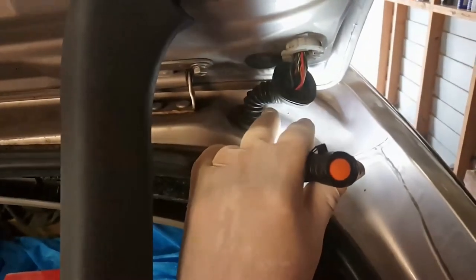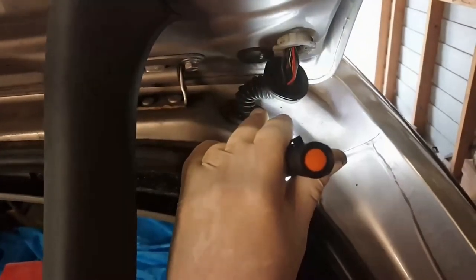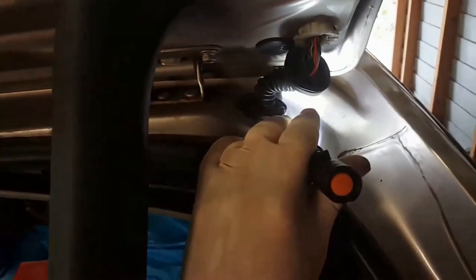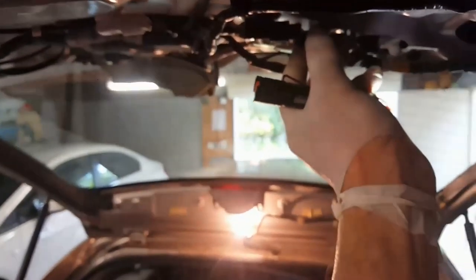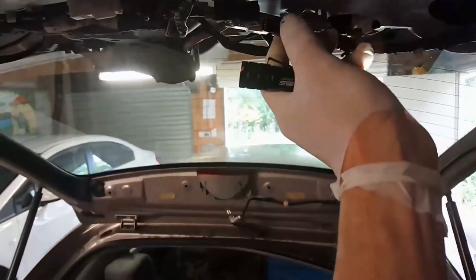At this stage it looks like I have to remove and cut this rubber boot off and just have a look at the wires. Another option is when I disconnect this connector here — when I disconnect this, the light will go on, and when I remove this, it'll go off. So I'd say it's probably the red wire. That red wire at the back there seems to be the power supply.